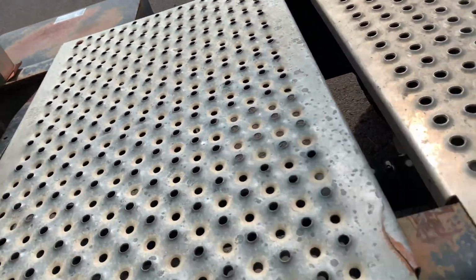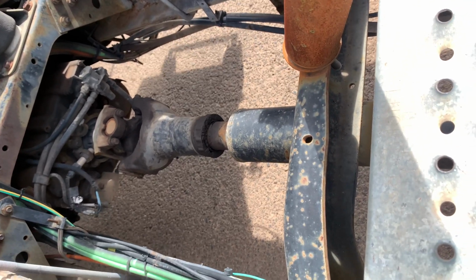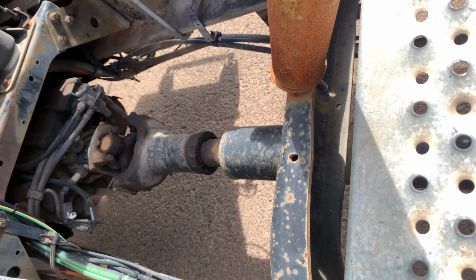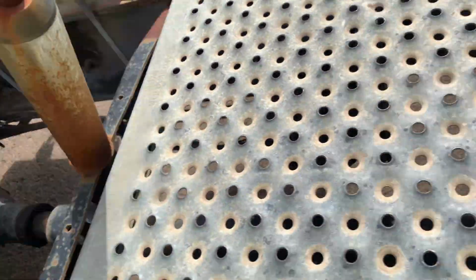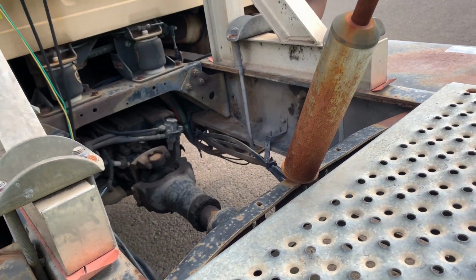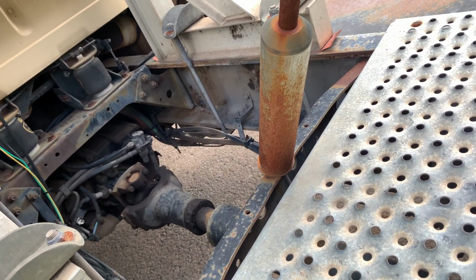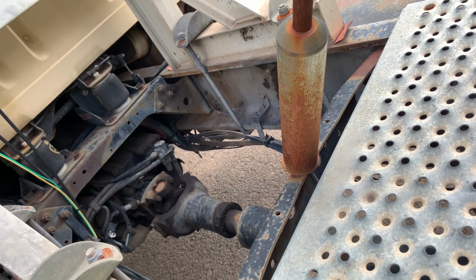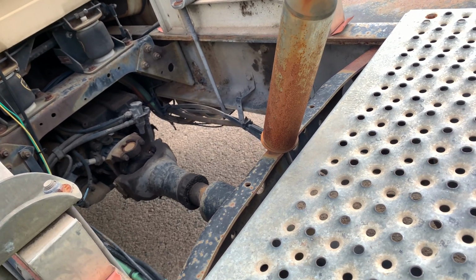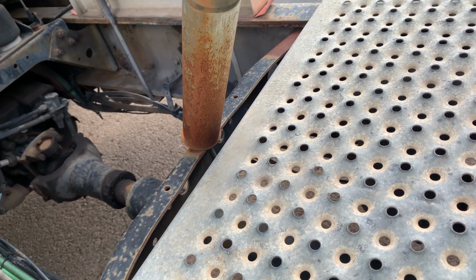My drive shaft is connected to the universal, which is connected to the transmission. There is a universal on the front and on the back. All the U-bolts, the nuts and bolts, and the bearing caps are tightly mounted to the universal on the transmission and the drive shaft. Then I check for bent, twist, crack, free of debris, properly greased.